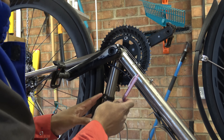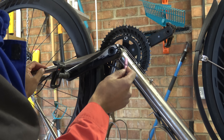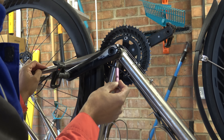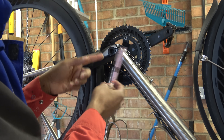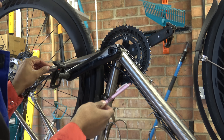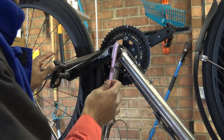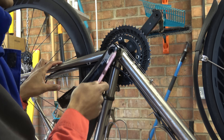I'm not sure if this has been threaded before welding or after welding. At a guess, I'd say it was threaded before welding, which is not the correct sequence in my opinion — but I've seen other people do it, like Boardman and most bike suppliers. Also, stress relieving: after you've welded it, you have residual stress inside the tubes. You're supposed to heat it up — for titanium I can't remember the exact temperature, but I'll explain it in the PowerPoint — and then you let it cool in air, which removes the stresses. This doesn't look like that's been done. The quality of the welding to the naked eye looks okay, but I have my suspicions.